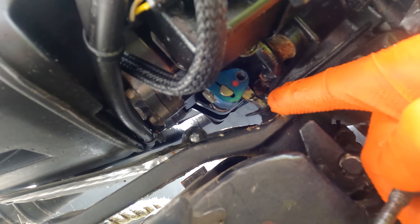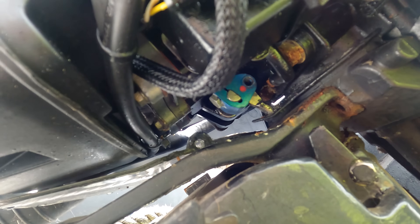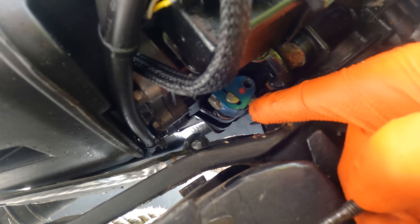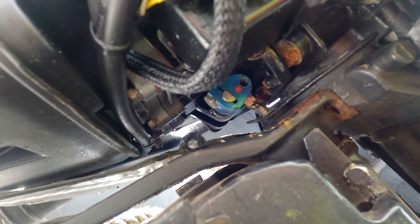The shift rod is disengaged from the control unit, so once the bolts are removed the unit will drop and this rod will go with it. If I didn't remove this pin, when all the bolts are out it would be hung up on here and we could probably cause damage or bend something. So remove that pin first, then you can remove all your bolts.